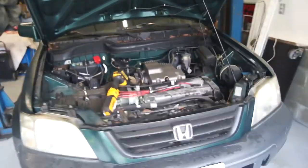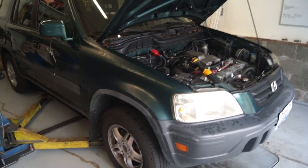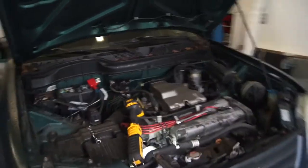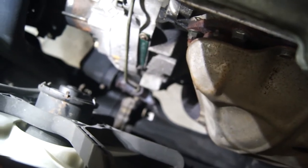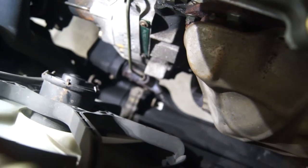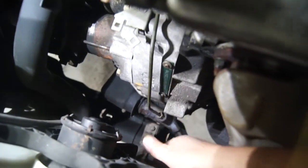Initially it was reported that the clutch was bad, but that's usually a sign that you either need to bleed the slave cylinder or it's bad. I wasn't going to do this video because it's usually pretty straightforward. If you look down there, it's this green line right here that goes to the slave cylinder — two bolts hold it in, then you put the new one in and bleed it. You can see the bleeder valve is right there, and that's the slave cylinder.